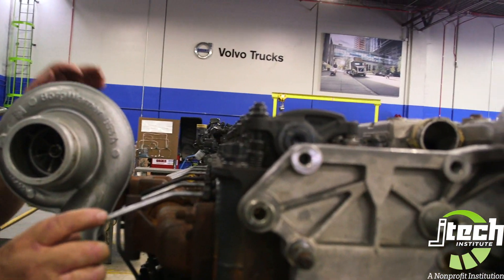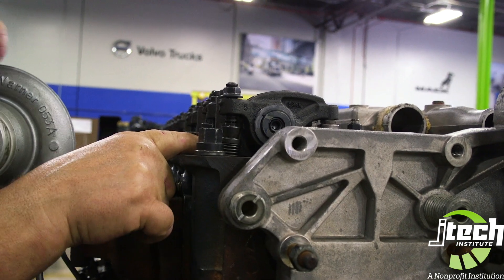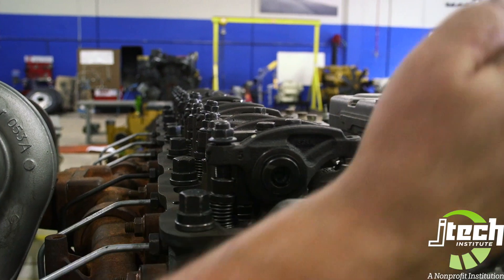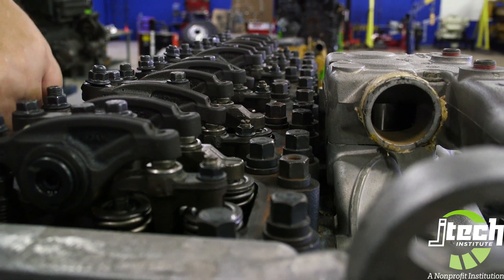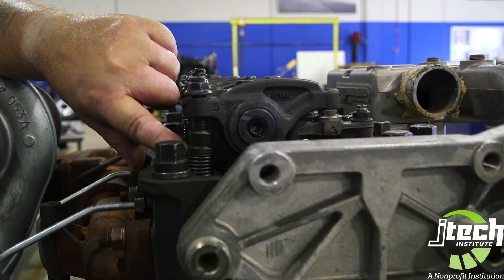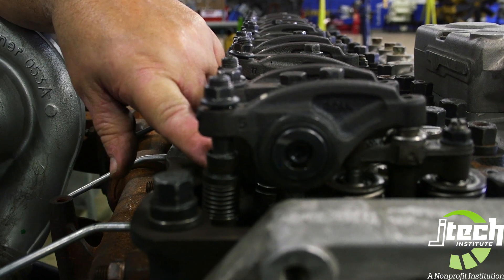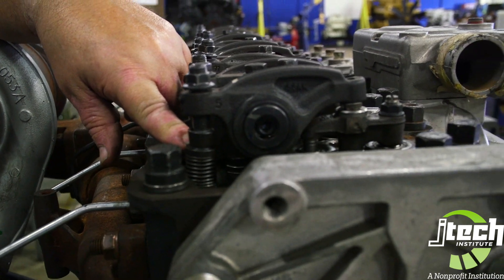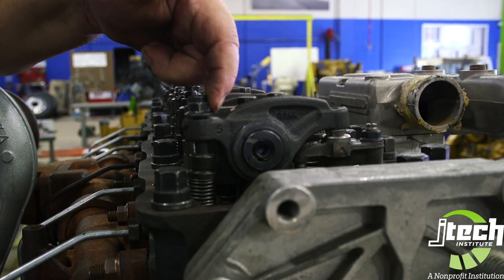Some of the things that you're going to need to know is which valves are which. If you look on the inside of the cylinder head itself on the top, there will be marked E and I. The intakes are generally on this side of the cylinder head, and then you have the exhaust which is on this side. You have the rocker arm, the adjusting screw, and the locking jam nut. Each rocker arm for each cylinder has these.